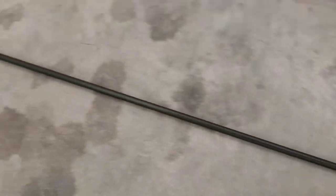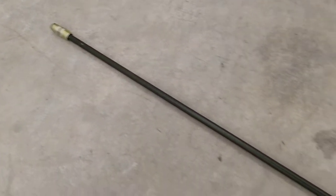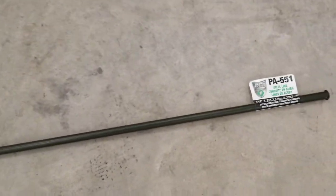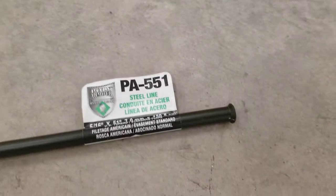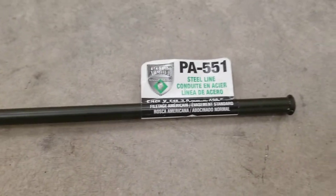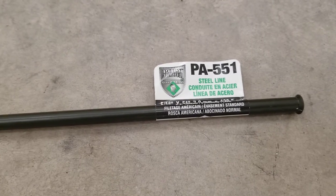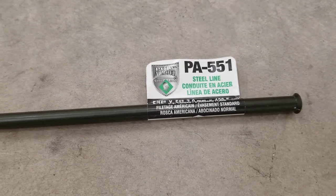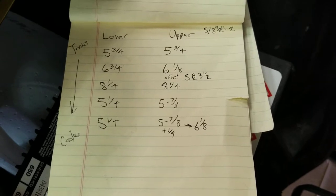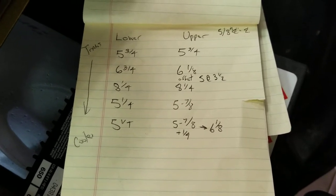The first thing you'll want to do is pick up some straight tubing. This is 5/16 inch, which is typical for the GM trans cooling lines. Get like at least a five-foot chunk, but get at least four because you're going to have a couple of screw-ups.